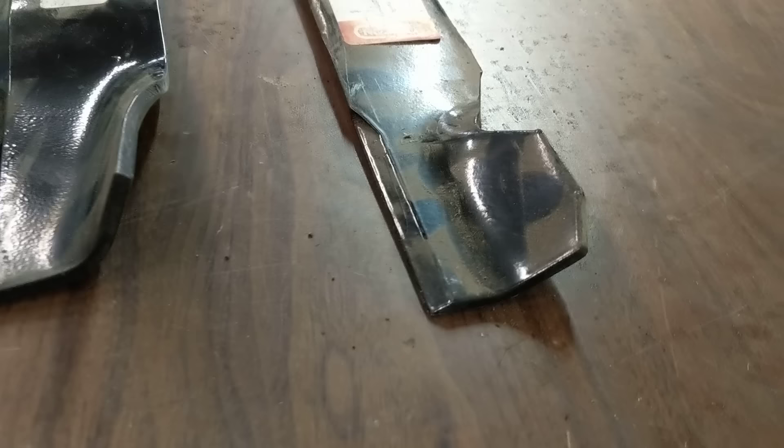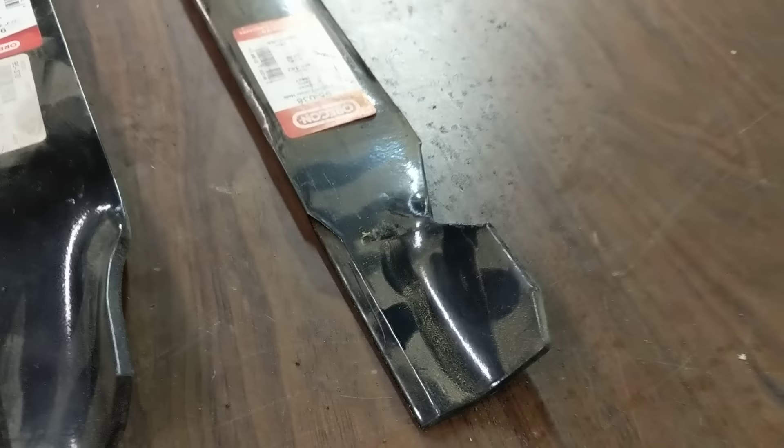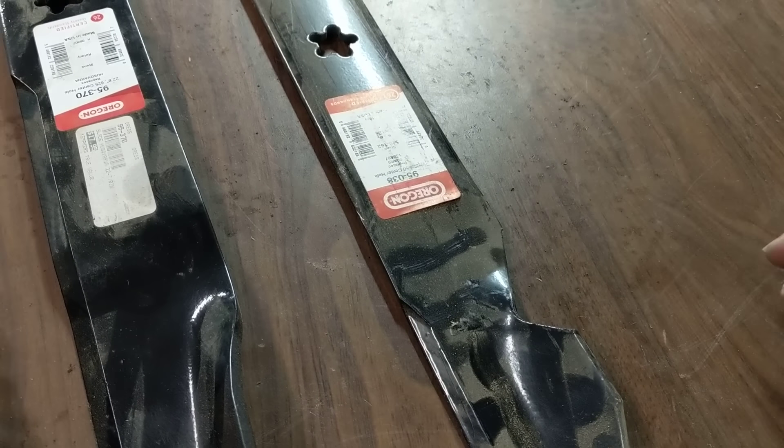There's what's considered a high lift or notch blade — that notch here is taken out. The lift is how high this stands up. There's low lift, medium lift, high lift, ultra high lift. That notch is supposed to make it a little easier to spin. The working part of a blade is generally the last three inches. The notch allows grass and air to flow over it, and in my experience it makes for a smoother running deck.